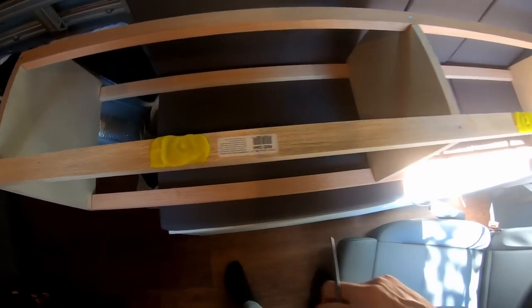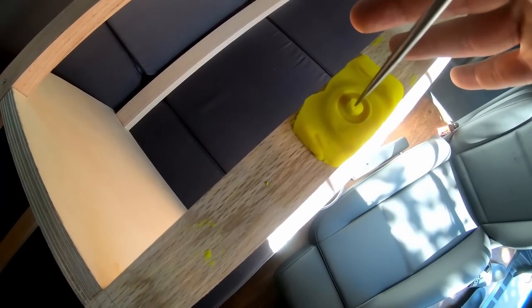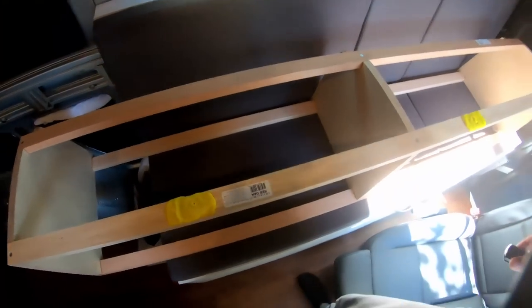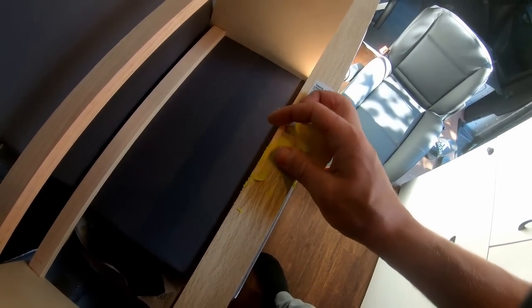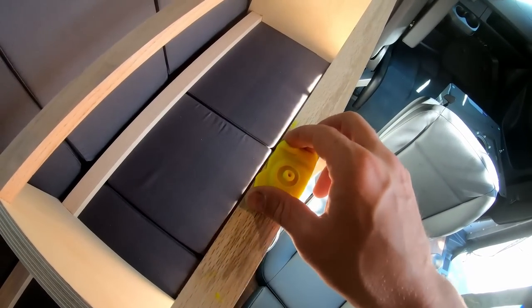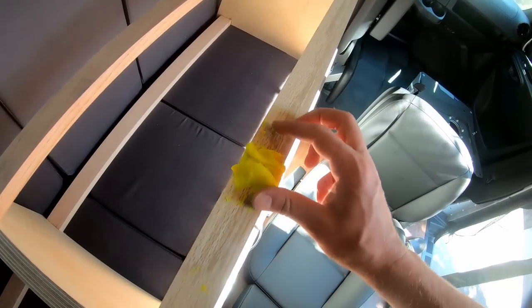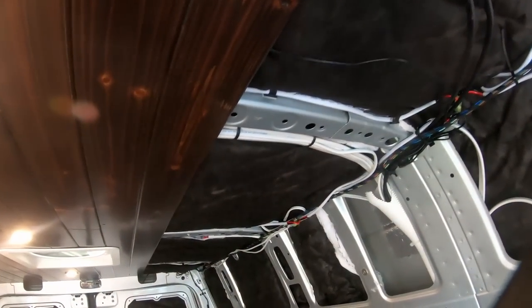On both pieces of Play-Doh we can see exactly where the plus nut is located when the cabinet is positioned perfectly to the top of the van. I take my awl, go right down the center, make an impression in the wood, then peel off the Play-Doh. Never thought I'd have a good use for Play-Doh after age five. We now have two perfect locations to drill holes to mount the cabinet to the plus nuts.